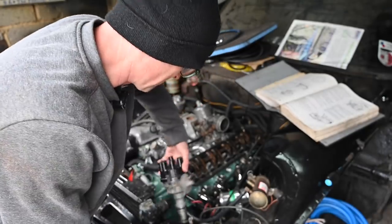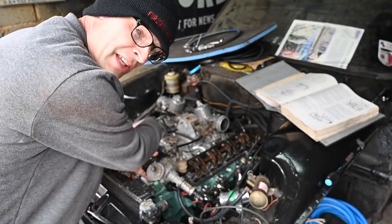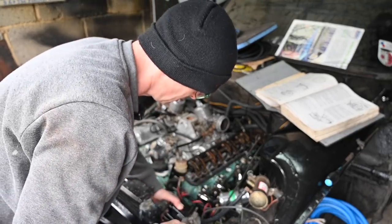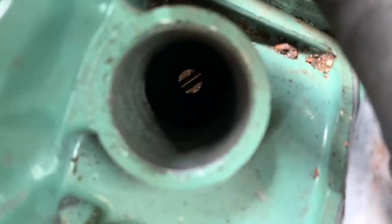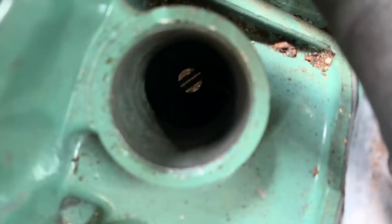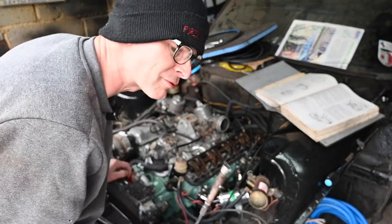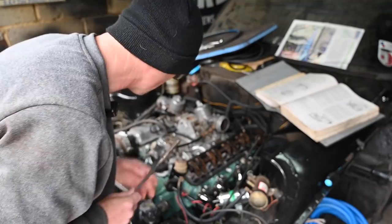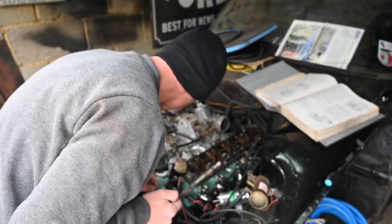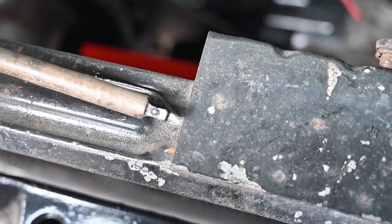This is the distributor — this gear wheel drives off the front of the camshaft, that's what spins the distributor. In the bottom of that there is a little key which drives a little peg in the top of the oil pump. But this priming tool replicates that — it's a little square box section that James made up, sits on that little peg. Except it doesn't, because on this engine the slot is reversed — male and female are reversed. I'm going to have to find something different.